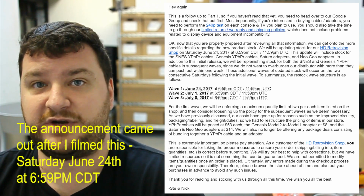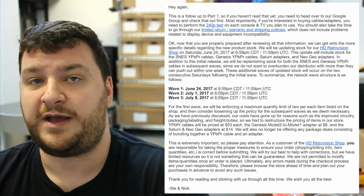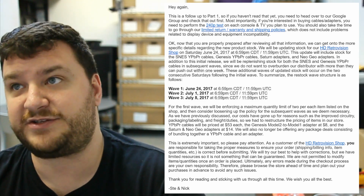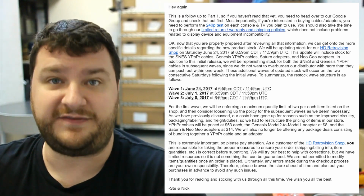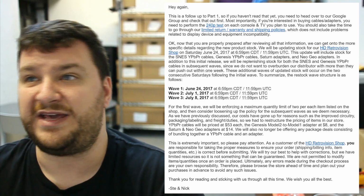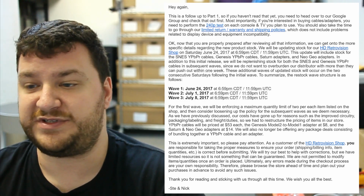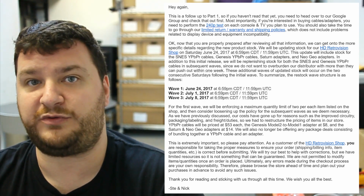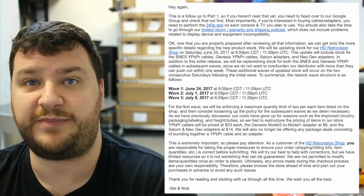So links in the description, and if you plan on buying one, just make sure to test your TV first, because a lot of flat screen TVs don't process 240p at all, and a lot of TVs in general process 240p as if it were 480i. Even some of those HD CRTs do that. So there's a link right on their website where you could go through some pretty easy tests. You don't need the component cables to do it. You could test with composite and just make sure your stuff's compatible and go from there.